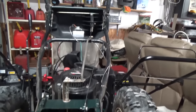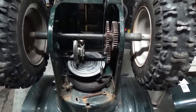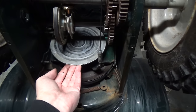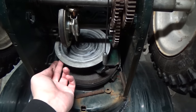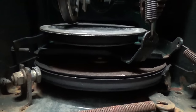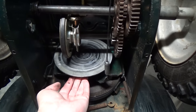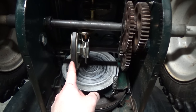This cable runs up to the right side of your handle, and that lever controls your drive. When you push on that lever it puts tension on this cable which lifts up this plate. This plate is always spinning when your engine is running because there's always tension on your drive belt. When you push that lever to engage your drive, it lifts up the spinning plate and transfers power to your friction wheel right here.